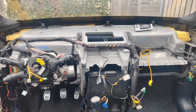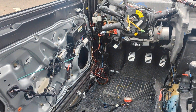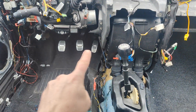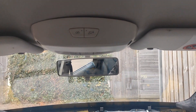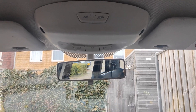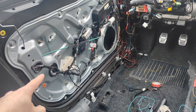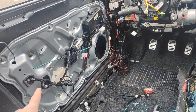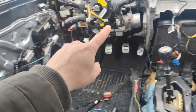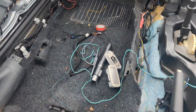So I cleaned it up a little in here. Before we install the dashboard, door panels, and seats, I need to do something about all that wiring. I want to install some lights over here, there, and underneath the seats. The plan was to use the ceiling lights, because when you open the door the light will go on. Someone mentioned that the lights on the driver side and passenger side doors also activate when you open the door, so the plan is to use that wire, cut it, and add new wires to run from the door panel and underneath the seats, with the wiring going through the door inside.